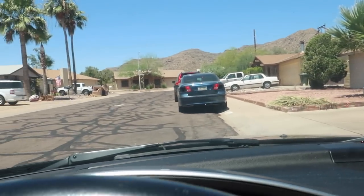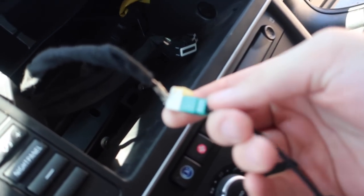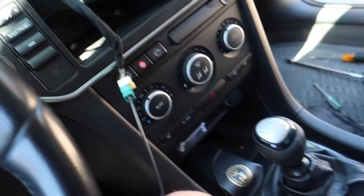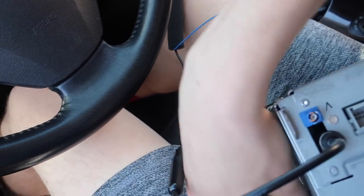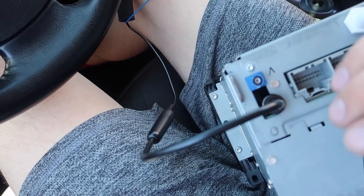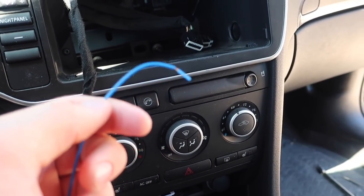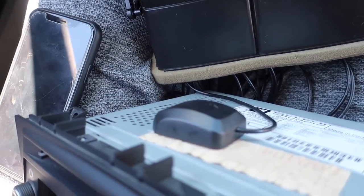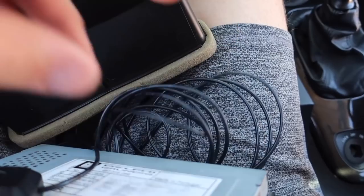So I'm in like Saab wonderland right now. The first adapter goes into this white piece right here and runs all the way into this adapter, which plugs into the nav unit right here. These two old connectors for the old radio are not going to be used. Lastly, we have our GPS antenna, which is going to plug into the blue outlet right there — we'll probably just mount that on top of the radio. There's also a ground wire, so Anthony went to get a 10-millimeter and we're going to ground it right on there.